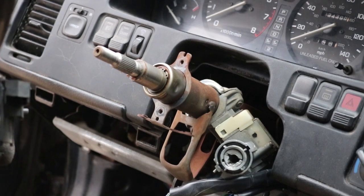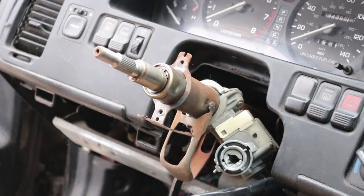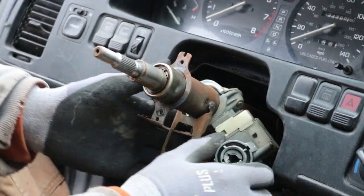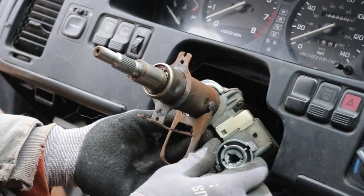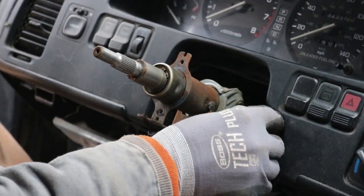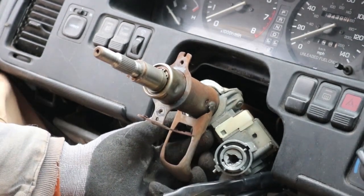So I just picked this car up a couple days ago. I used to own this car, and we were having some issues, so we sold it. The issue we had is that whenever I was putting the head back on, one of the bolts stripped out. At the time, I didn't know how to helicoil anything, and I had a 2014 Chevy Sonic that I ended up having to helicoil. I think it was just the valve cover. But in this case, I'm gonna get a Time-Sert kit, which is gonna be stupid expensive, but that will solve my problem. So I'm gonna go ahead and do that, so that way I can get everything situated. I'm trying to see if there's a way to get this off without having to cut those bolts or anything, but I don't think there's any way actually.